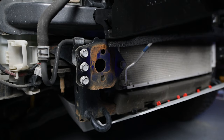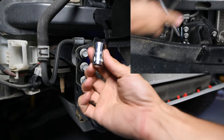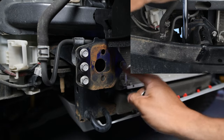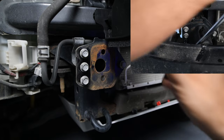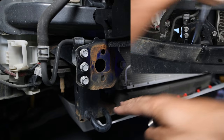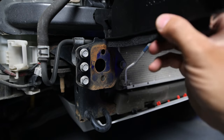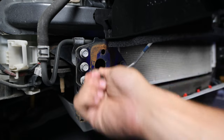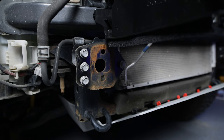With the bumper cover off, remove your impact bar. You'll need a 14mm and there are four bolts on each side. A breaker bar works quite well — it can be a little difficult to get in due to your skid plate and air deflectors. Loosen all the bolts on each side and pull your crash bar or impact bar out and set it aside. This is where we'll bolt up the new BodyArmor Highline Winch Bumper.